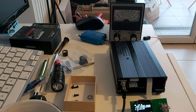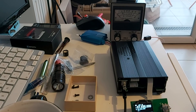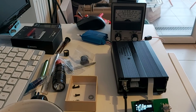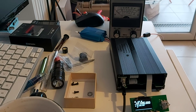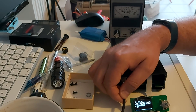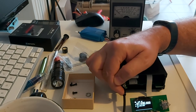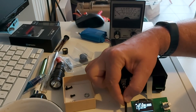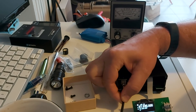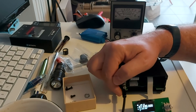I'm going to press the microphone trigger and say one-two, one-two. There's no power deflection on the watt meter — nothing's coming out. That might be where the contact is bad, so it really is the microphone jack. I'm going to try speaking while I wiggle the cable to see if the problem is in the jack rather than inside the radio. Still nothing moving, so I really should visually inspect the jack inside the radio as well.